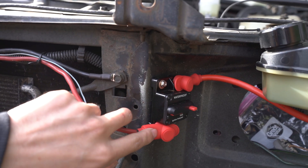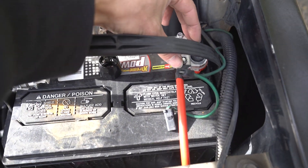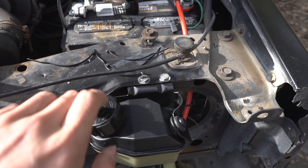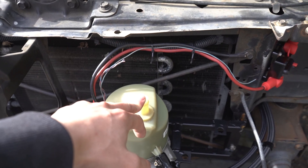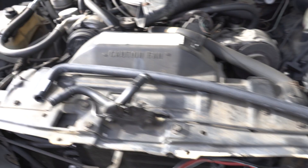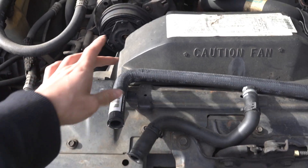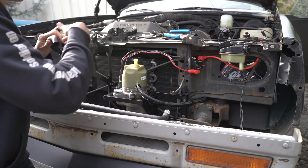I have it going through a fuse and then coming up to the top. What I really like about these G-bodies is they plug into the car through screws on the side, so I can use those posts to connect any accessories. For this bracket I did have to cut it up so it fit better, then screwed it in and painted it black — it barely clears the hood when closed, but it clears. The next thing is connecting the reservoir to the pump. Originally I had some AN-10 hose but it formed a giant S and looked ugly. So I'm using the original hose and a five-eighths heater hose for an LS swap — I got it for the 90-degree bend — cutting them up and joining them with a heater hose connector to make a custom hose.